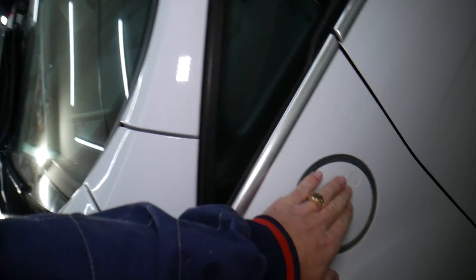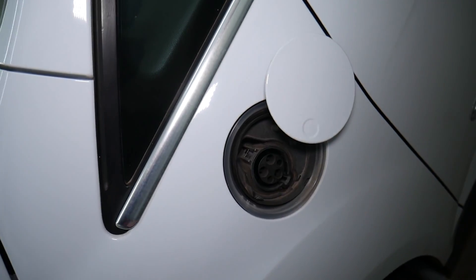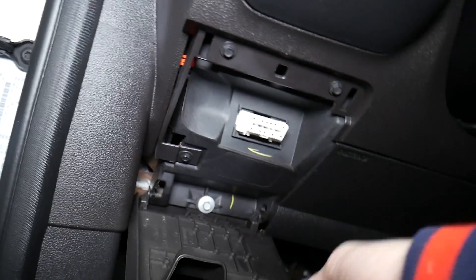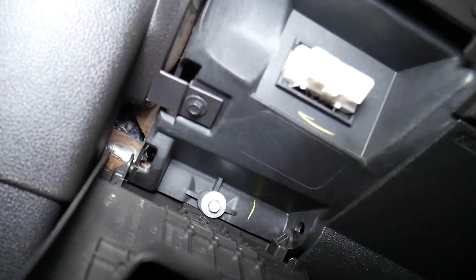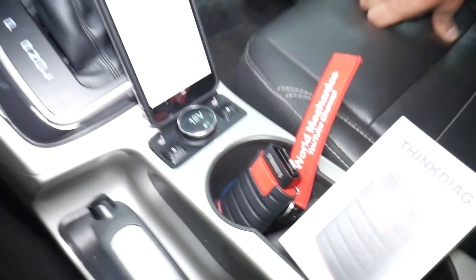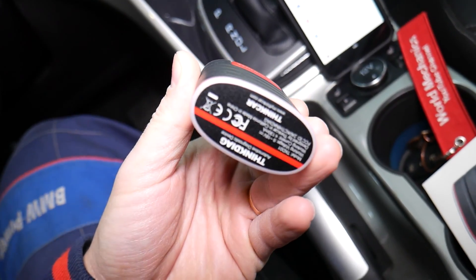So, this is a plug-in hybrid electric vehicle — a Ford C-Max Energi, you can see the plug-in port right here. To test the battery on these modern cars it's pretty easy. You need to find the OBD port. In our case it's right here under the dash; yours may be somewhere under the dash or under a cover like this one. That's what it looks like — just a standard OBD port.